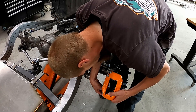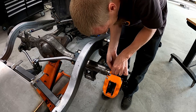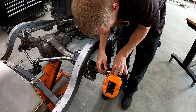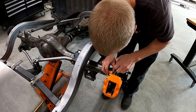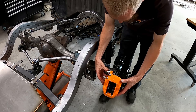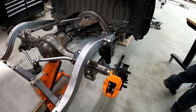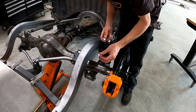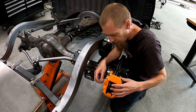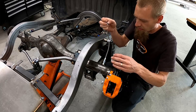Note that we're preparing this for paint so this isn't the final install. Both bolts go in there and you put the castellated nut on — there's also a cotter pin to install at the very end, but don't do that until the very end. Shim it and figure out exactly how it fits. For the brake line side, you'll need this adapter fitting — eighth-inch NPT — which goes in the back of the caliper. Tighten that up.